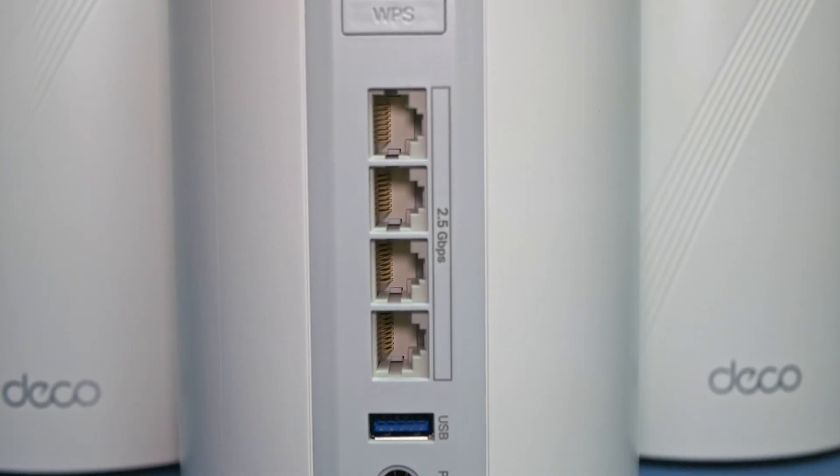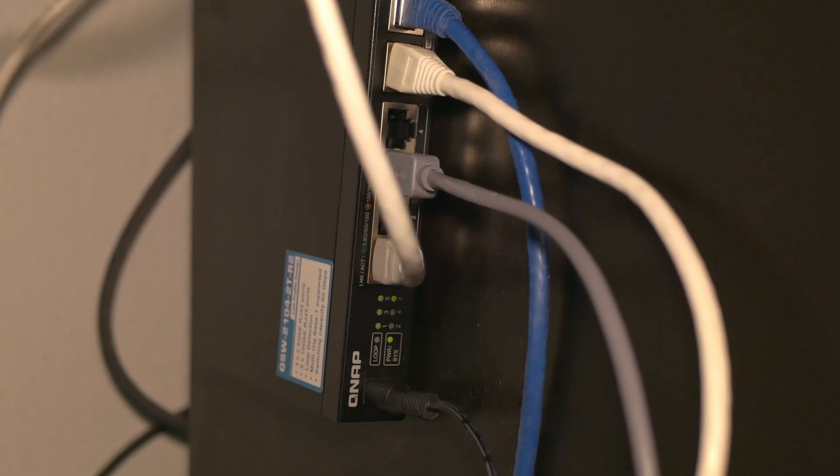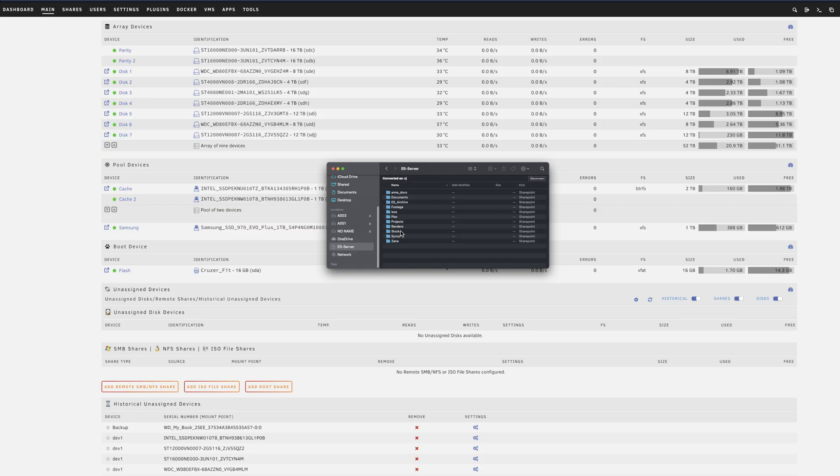Then came the real test — reconnecting all my devices to the new network. That took an entire afternoon. If I were smarter, I would have just reused my old SSID and password, but it was time for a fresh start security-wise. Not everything in my house is wireless — I've also got several devices that rely on wired connections. Each Deco BE63 unit includes four 2.5 gigabit Ethernet ports. On the main unit, one is connected to the cable modem and another goes to my multi-gig network switch, which connects the 10 GBE ports on my Mac Studio and main server, as well as a secondary switch in my studio. After a quick reboot, all my wired devices grabbed fresh IP addresses and connected flawlessly — even my storage server showed up using its device name without needing to reconfigure anything.